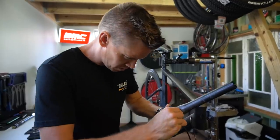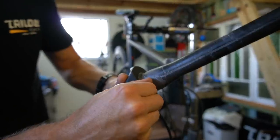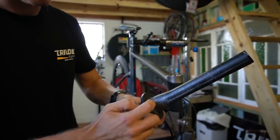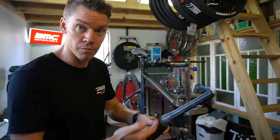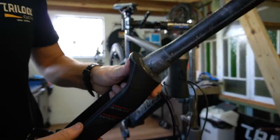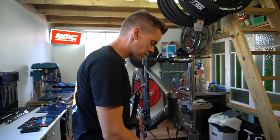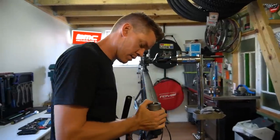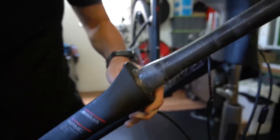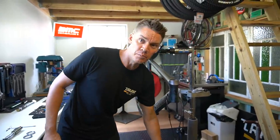That's pretty bad. There's also a lot of pitting on that race. Pitting is where the carbon is actually not finished properly. If you had a specialist scan that, those would be voids — pretty obvious. You can see the bearing seat has an imperfection. The main reason I take these out is to inspect if the bearings are dry — and we have a fully dry upper headset bearing. They are bone dry. I really want that going through to the lower assembly of the steerer tube.